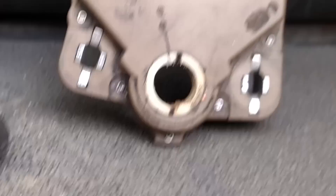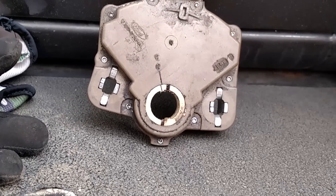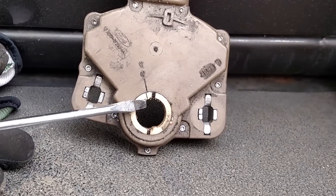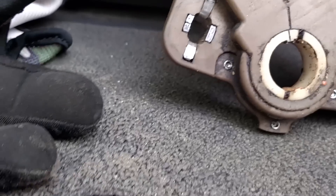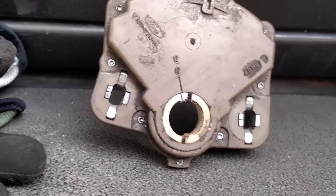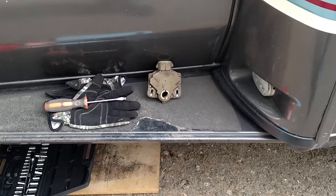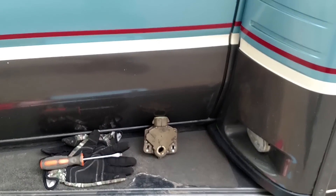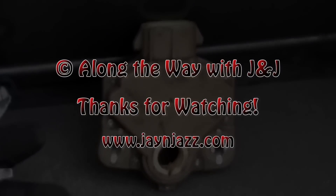When I took this off, the first thing I did — other than disconnect the battery — was put the shifter on the steering column in neutral, so I knew where it was when I put it back on. With that in neutral, these lines should have been one continuous line. And if you look at it, it's not exactly matching up. So this may or may not have contributed to our transmission problem where it seems to come out of gear and go to neutral. Tomorrow we're going to do the transmission fluid, filter, and gasket, because another cause could be the wrong filter in the transmission.